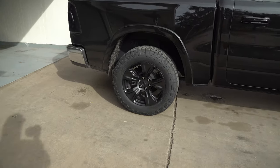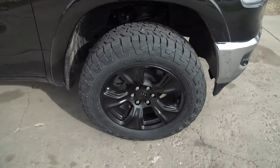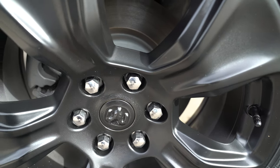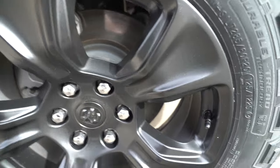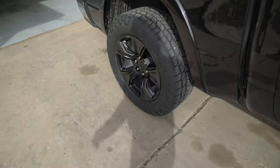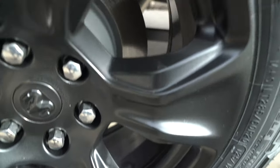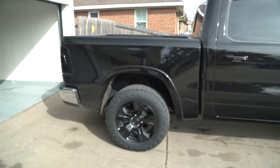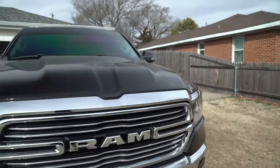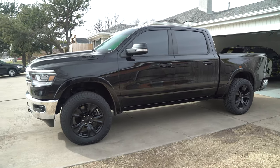There it is guys — changes the whole look of the truck. These wheels don't look half as bad now that they're painted black. I think it looks ten times better. The only problems I ran into: it kind of flaked and speckled in some spots because it couldn't cure properly — it was just too cold last night. Also some overspray in the barrels. So I just took a rag with some Goof Off and wiped the areas clean where you don't want any overspray. Still need to delete all the chrome in the front and on the bumpers, but just by changing the wheels, look how much different it looks — like a completely different truck.